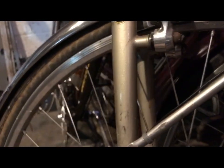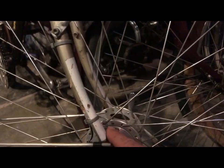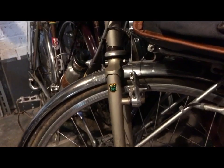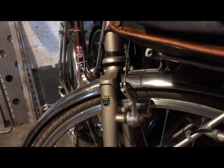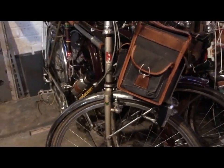I've also started carrying a front bag in recent times — about the last 12 years. For a front bag it would ideally need a little bit more rake — the axle about here — which gives lower trail and improves the handling when you're carrying a front load. So I've always wanted for a few years now a good 531 lugged fork with a wider crown and slightly more rake, but still with the brazons. And I have such a thing, and we'll come to that in a couple of minutes.